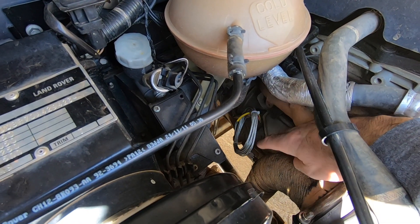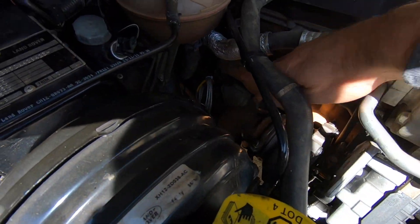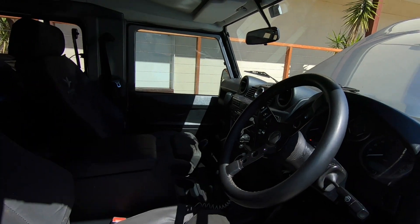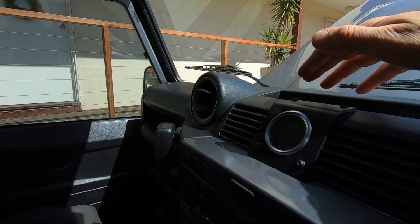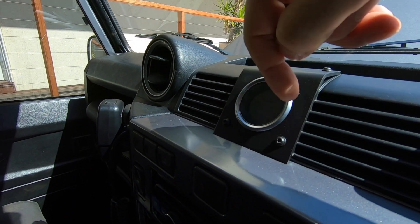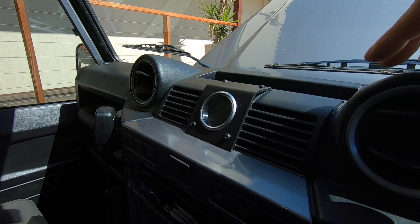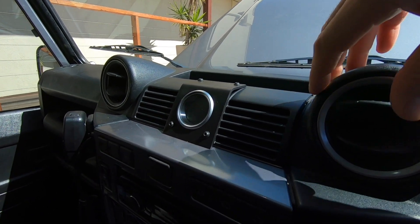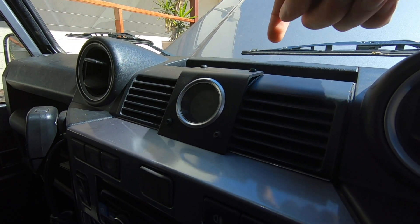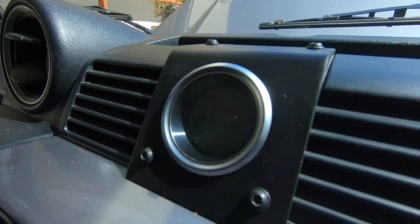You can see the bung has been welded and fitted to the pipe off the back of the turbo, which is here. I've also mounted the gauge and made this mount — my Land Rover factory clock was in this position, so I've blocked these vents permanently, which forces more air through the other vents. I just bent some aluminium up, cut it to size, and used the screws from the clock to fix it to the plastic.